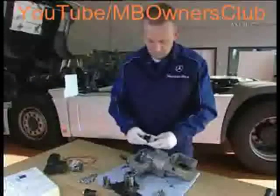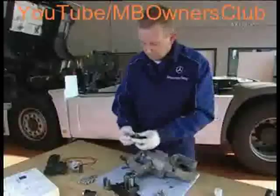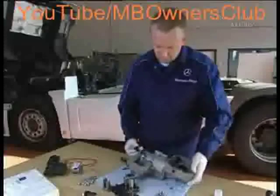Now start with the installation of the new gear sensor. The contacts are already greased — this special grease is important because it prevents the formation of corrosion. Place an o-ring on the sensor and cover it with the grease from the parts kit. Then insert the new gear sensor, making sure of the correct installation position. The notch on the gear sensor must be towards the connector frame.